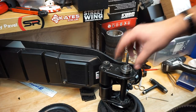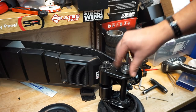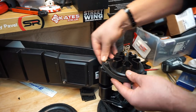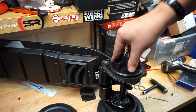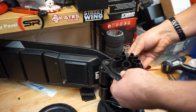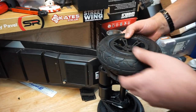What I'm using is a felt gasket — you can buy them in a plumbing shop. That goes in first, then the rubber washer. This is just in case after you assemble everything you feel some sort of rubbing sound — take a look closely, because that could be exactly what I just described: the wheel pulley touching the motor pulley. I almost forgot — the bearing goes in as well. So the order is: felt washer, rubber washer, and then the bearing.